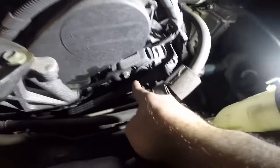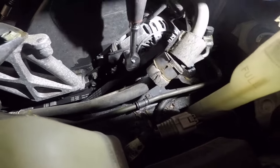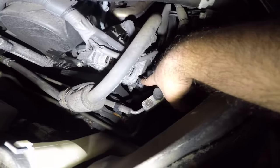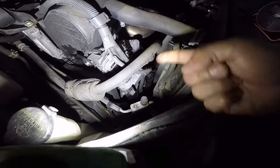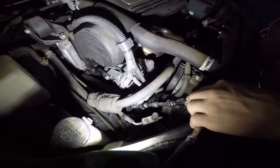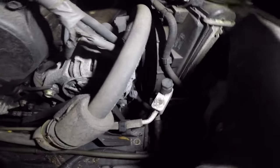Also going to get this one right here - that's a number 14 - we're going to loosen that two to three turns. What that's doing is just gripping the alternator in the spot. So this is the alternator and AC belt. Now we'll go over to this top bolt here - this is the adjustment bolt. We're going to tighten that, going clockwise. What that's going to do is pull the alternator, which is going to tighten the belt from being stretched out. That's a number 12.